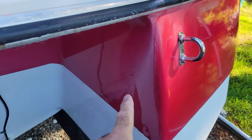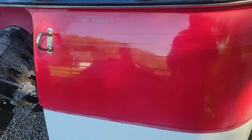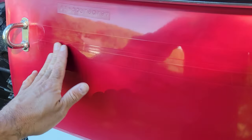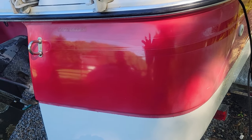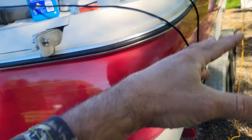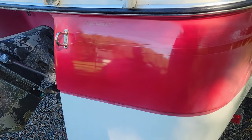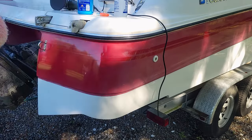Look at that — where we didn't have shine before, over here you can see a little bit, but I did all of this with the Meguiar's 67 one step and it didn't bring it back. Over here you can see how it was versus how it is. A combination of the wet sand and the 91 I think is doing a nice job. Do I really want to get a 600 and go through this, or do I want the boat in the water this year? I think I want the boat in the water this year. I might hit it one more time with the 91.